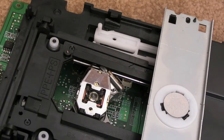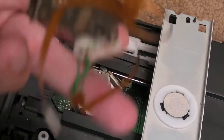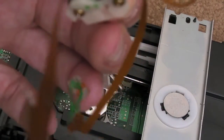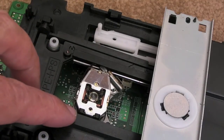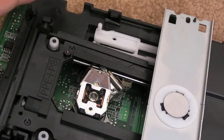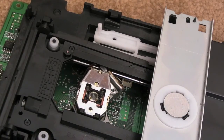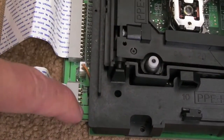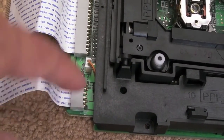You've got to compare like for like. No good having an aftermarket laser assembly with a different value pot — if you start adjusting based on that you'll set the wrong voltage level on your laser. But 99 times out of 100 you'll get something identical, so I was able to look at the default value of this pot compared to that one and see this one is pretty much in its original state — though someone has tinkered with it slightly and it looks a bit mangled.